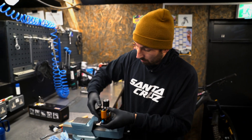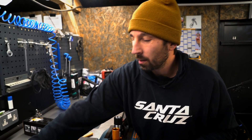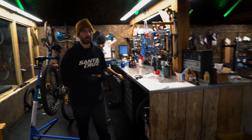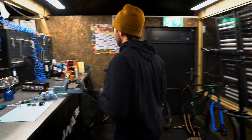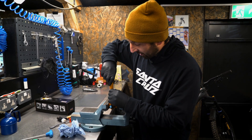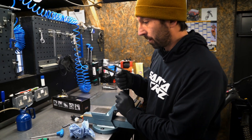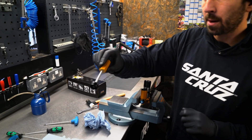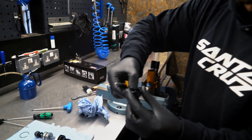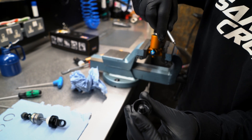Now we can take out the pressure cap. Another little circlip, and this is where we need our first special tool. We'll screw this in here — it just allows us to pull the pressure cap out. That's our pressure cap, and that's the thing we put the nitrogen needle through earlier. That holds all the pressure back. You can see this rubber puck here — a little pressure seal.